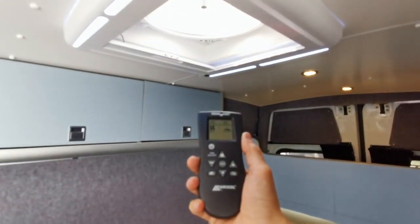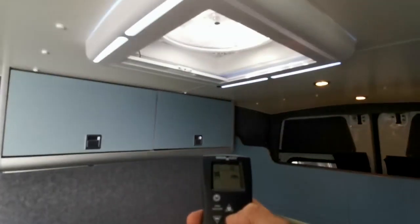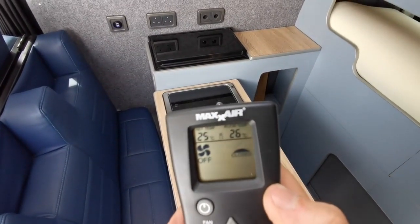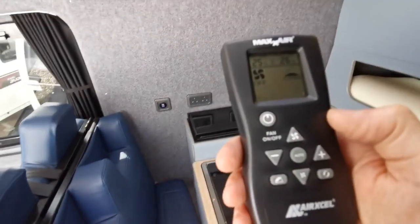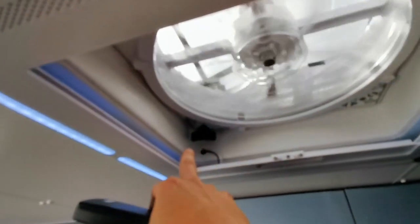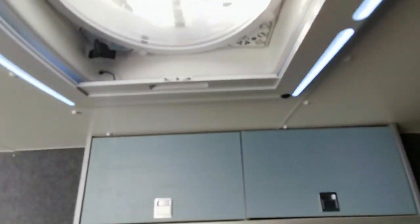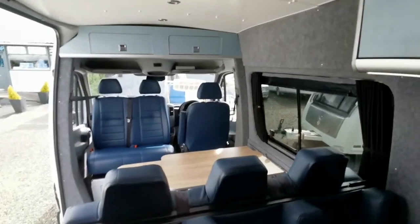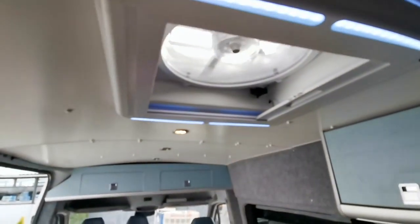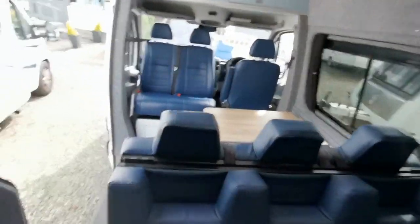Up here we've got a Max Air — a quite expensive remote control ceiling fan which is fully remote controllable. It tells you your internal temperature and you can set a temperature where it automatically opens. If I press up, it turns the fan on and winds open the roof light — it can extract or blow, and can quite effectively remove a lot of the heat out of the van. The van is obviously insulated as well and has curtains on the windows. They do advertise that you can drive with these on as well, and obviously you've got your cab air conditioning too.